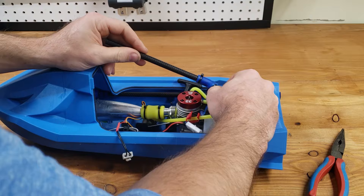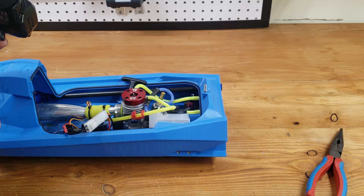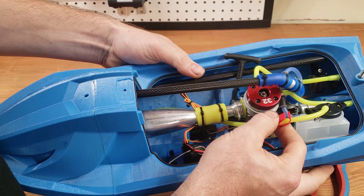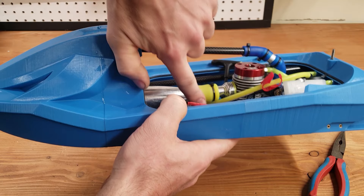It's that simple — everything is where it needs to be and working as intended. You want to make sure your carburetor fully opens at full throttle and fully closes at full brake — it's the only way to stop the boat if it runs out, so make sure that is working well. Now is also a good time to do a final inspection of every screw to make sure you didn't forget to tighten them or put a locking washer — if you did, you might find loose screws at the bottom of the boat later on.